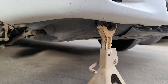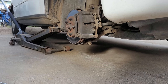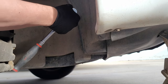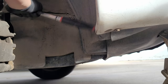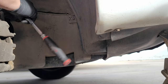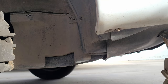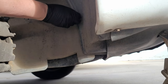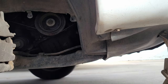To get started we're going to want to remove the wheel, but to do so you're going to want to lift and support the car with a jack and jack stand. I also lift it from the other side to take pressure off of the sway bar, since we gotta detach the end link to remove the control arm. But with our wheel off, the first thing I do is remove this cover held on by two bolts that we use a 10 millimeter socket to remove. With that cover off we now have better access to everything.